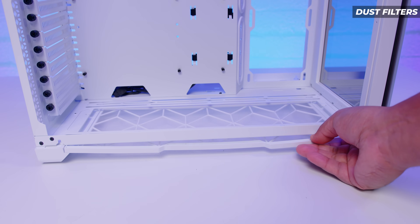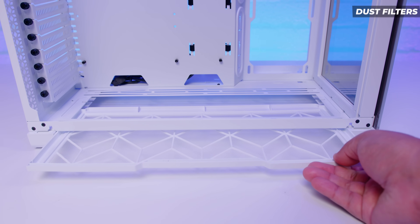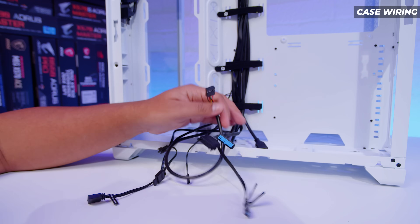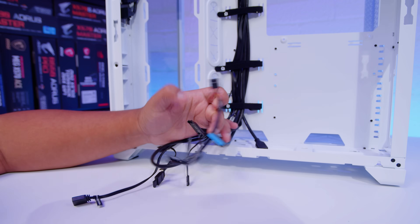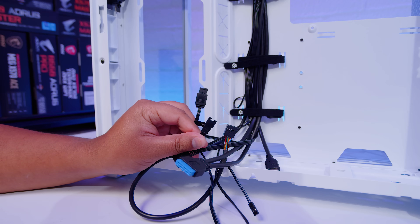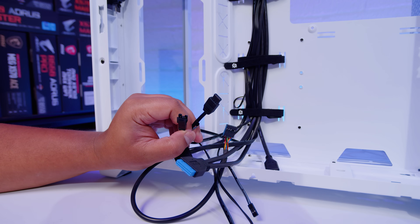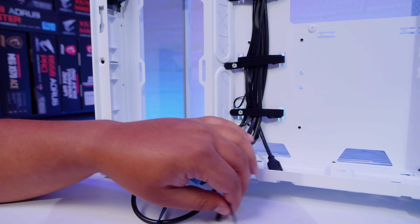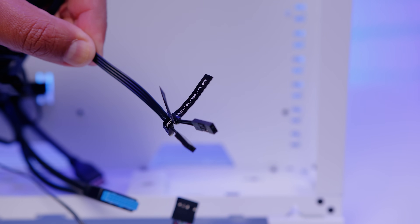There's a single removable dust filter on the bottom of the case — just slide that out. Nothing too special, it's just a dust filter. For front panel connectors, we've got a USB 3.2 connector, front panel audio, SATA power for the built-in RGB controller — because this does have built-in RGB for the infinity mirror front if that's the SKU you choose — as well as a USB Type-C front panel cable. Because of the built-in RGB controller, you can use two types of RGB: the connector typically found on fan hubs, as well as 3-pin 5-volt addressable RGB. There's also motherboard pass-through so your motherboard can control everything, along with all standard cables for lights and switches. These cables have labels recommending which to use if you're going for a dual system setup.